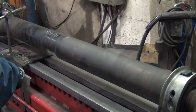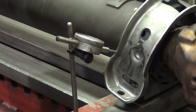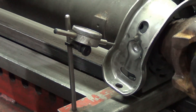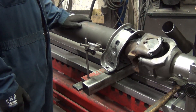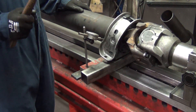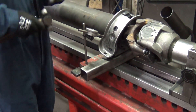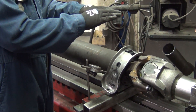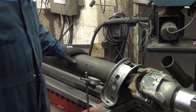That made a huge difference. One little trick you can do when trying to straighten the stub or splined end of a driveshaft: normally you're looking for a high spot, but in this case I'm looking for the low spot, which is right about here. I'm going to take a small hammer and hit directly on top of the weld and flatten it out. That's going to push the weld down into the groove and spread the driveshaft, which is actually going to lift it up. It's a weird concept to grasp, but it works really well.